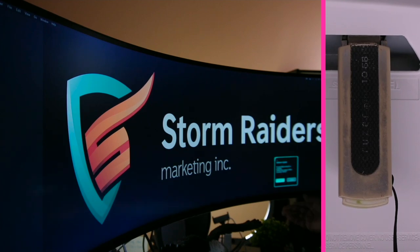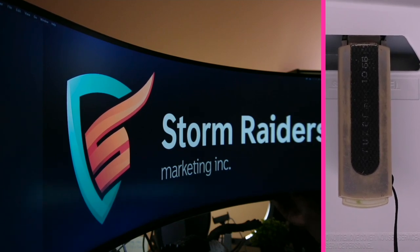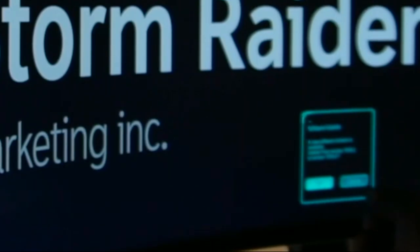There are two USB ports on the back of the monitor; you must insert the USB stick into the port labeled 'Service' — it will only work in that one. Once inserted correctly and Software Update is selected again, it finds the file and compares versions: current is 1010.2, new version is 1016.0. I click OK and the software update begins.